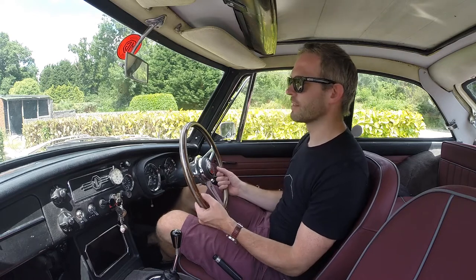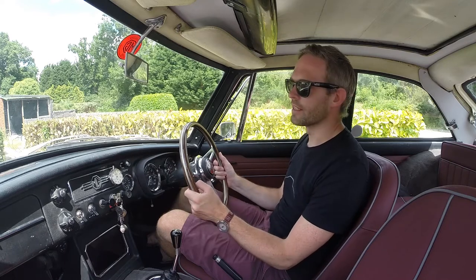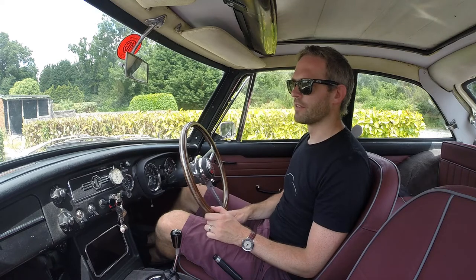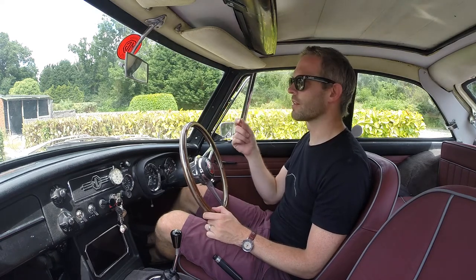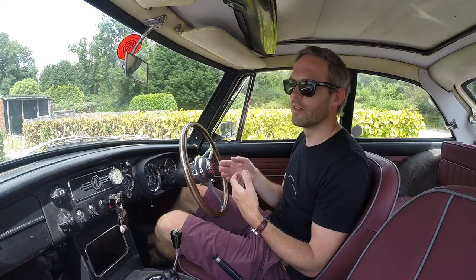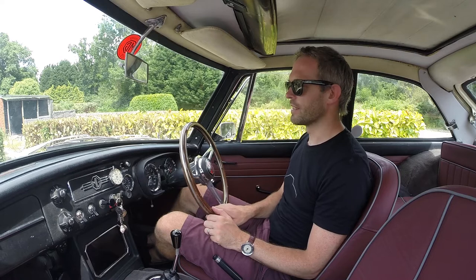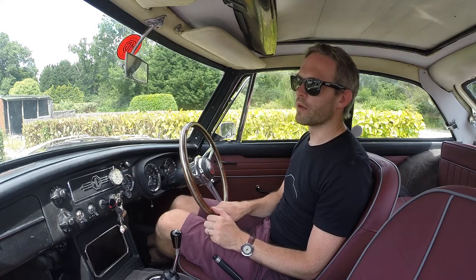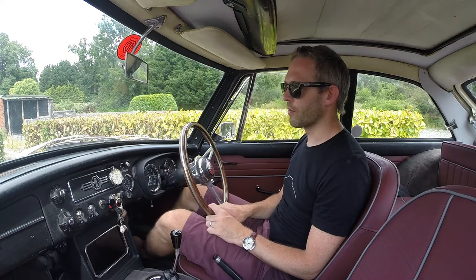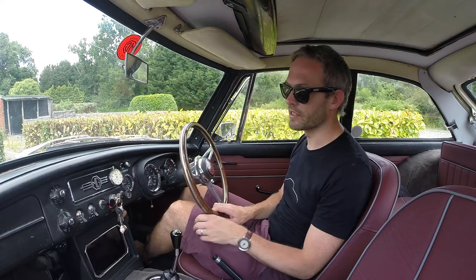This particular car is a 1967, and from 1965 to early 1967 these are known as the Mark I GTs. They have some differences to later models, one being the three synchromesh gearbox. They also have different style A-pillars — on the outside there are little chrome sections, though mine have been painted body colour. These chrome A-pillar trims are only found on the Mark I GTs. Late 1967 was probably when the MGB Mark II arrived, and this updated the gearbox to a full synchromesh unit.